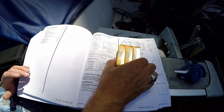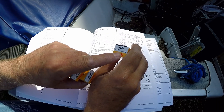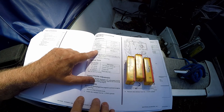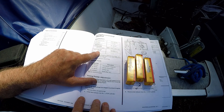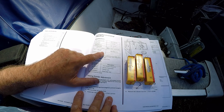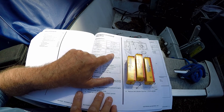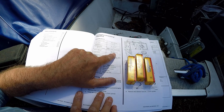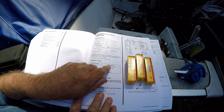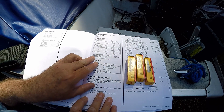I got the spark plugs brand new — BP8H-N-10s. Takes three of them. Spark plug type for 50, 55, and 60 horse Mercury two-stroke three-cylinder motors. It says over here NGK BP8H-N-10, but a substitute using the Z is also acceptable.